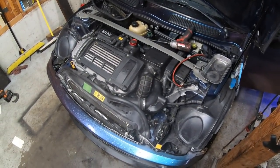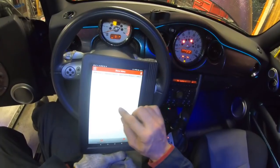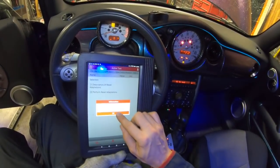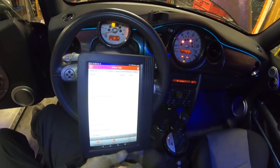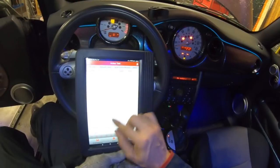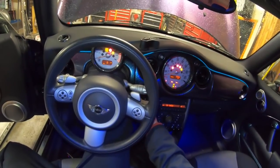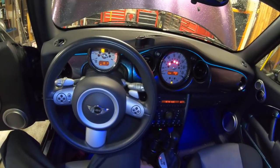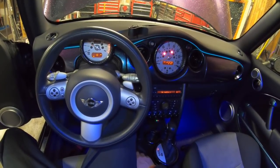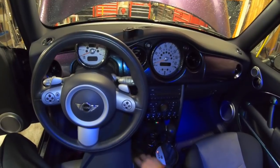So that's all the mechanical work, but we're not quite done yet — we still need to talk to the computer. First, I'll clear the fault codes. Then I'll go into special function and reset the throttle adaptations. I recommend resetting the adaptation for the throttle body. If you don't have the tool to do this the car would probably run okay, but I highly recommend it — I'll put a link in the description to tools that can perform this operation. I'll turn the key off to allow the car to write the settings, then turn it back on. The throttle body is now responding to accelerator inputs, so I'll take the car for a test drive and hopefully the codes will be gone.